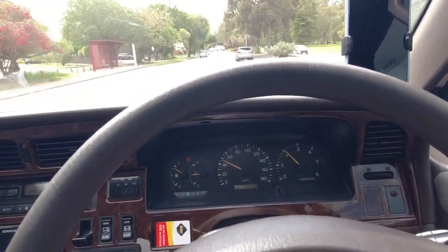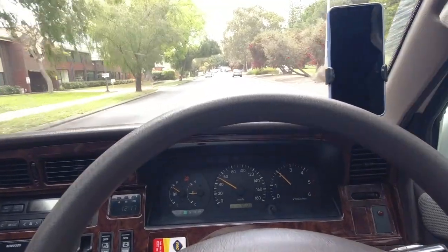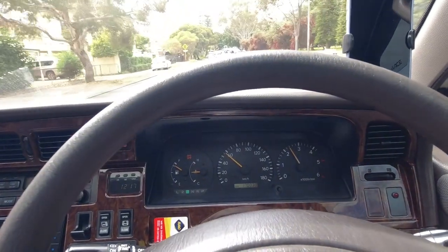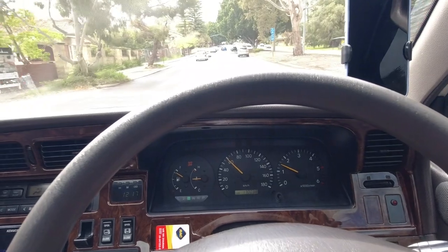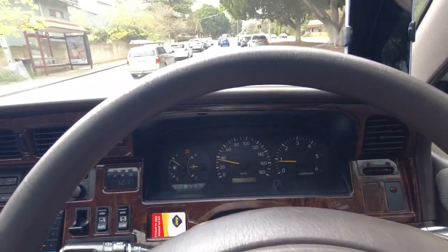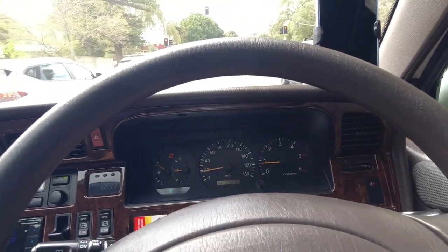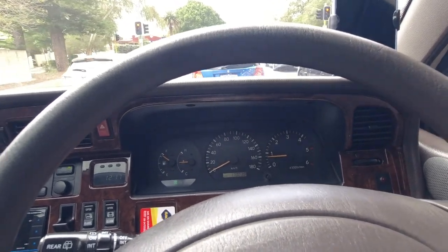There's a red light coming now, and a 1% battery, won't be able to show you, but you'll see this lockup now. That was torque converter lockup. So you know that the torque converter is locking up. It'll only happen at full running temperature. And that is my rough guide on what I would look out for when buying a Hiace super custom.